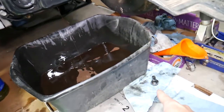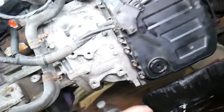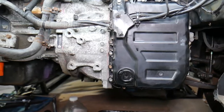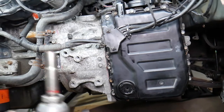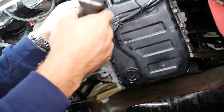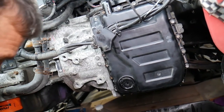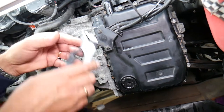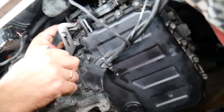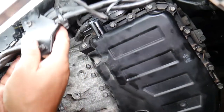When reinstalling, use a new washer on the drain plug. We have a video on the channel showing how to add transmission fluid and check the fluid level. Now, using a 10-millimeter socket, remove one bolt for the wiring harness to get it out of the way. Then grab some pliers — we need to disconnect the breather hose right here.